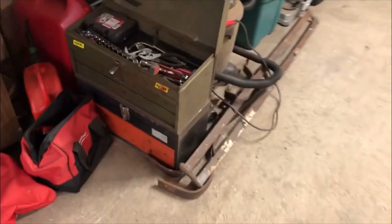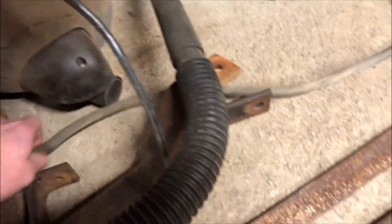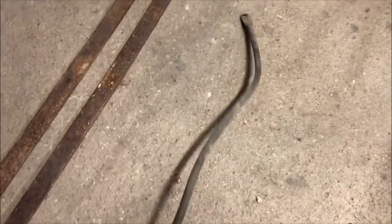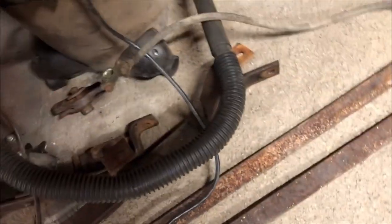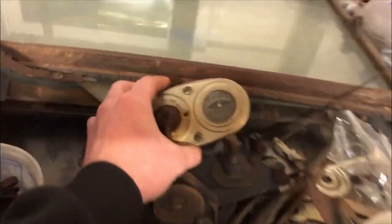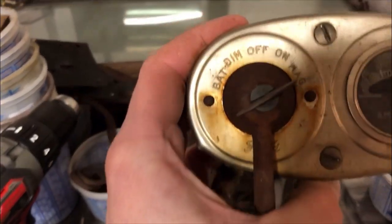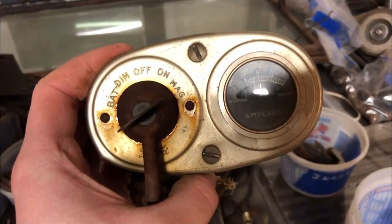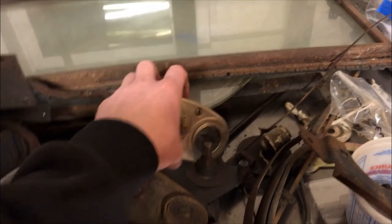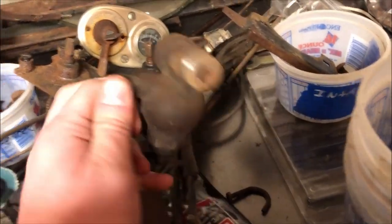Here are some of the bumpers — this is the front bumper. Some of these parts are in such good condition. Look at this battery cable — it looks almost brand new and it's from 1926. We'll probably get a new one but you could use that one if you wanted to. Here's the instrument panel: you have battery, dim, off, on, and magneto. You could start it on the battery and switch to magneto — they tended to run a little better on the magneto. There's an amp gauge so you can check your charging.